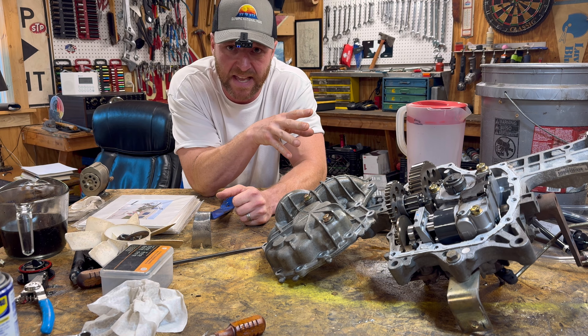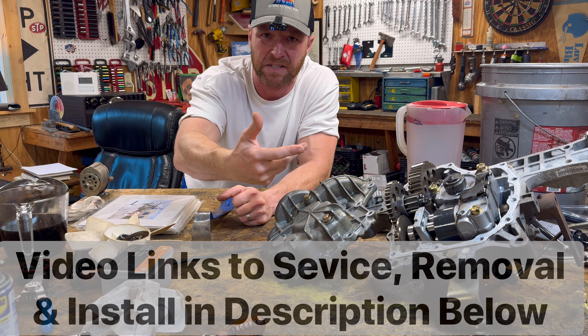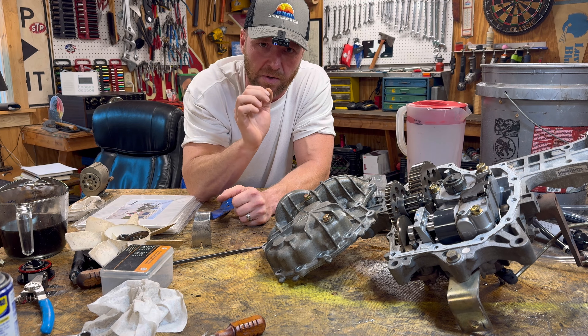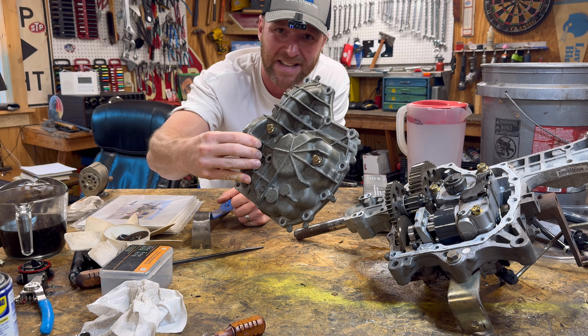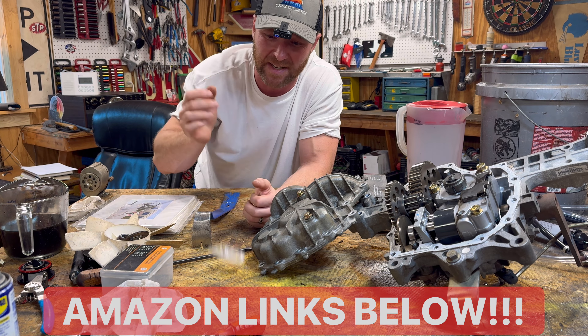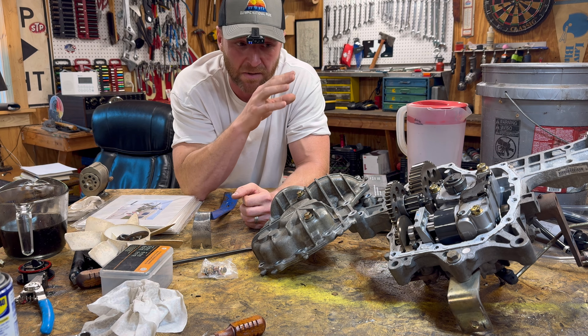What we've got here is a K58 transmission — I'm doing the full service right now on it. It's the same build as a K46 underneath all your riding lawnmower transmissions. This is a cool thing to do while you're working on the transmission. I have added two drain plugs. It is fantastic because you can buy these drain plugs on Amazon for about $11 to your door.